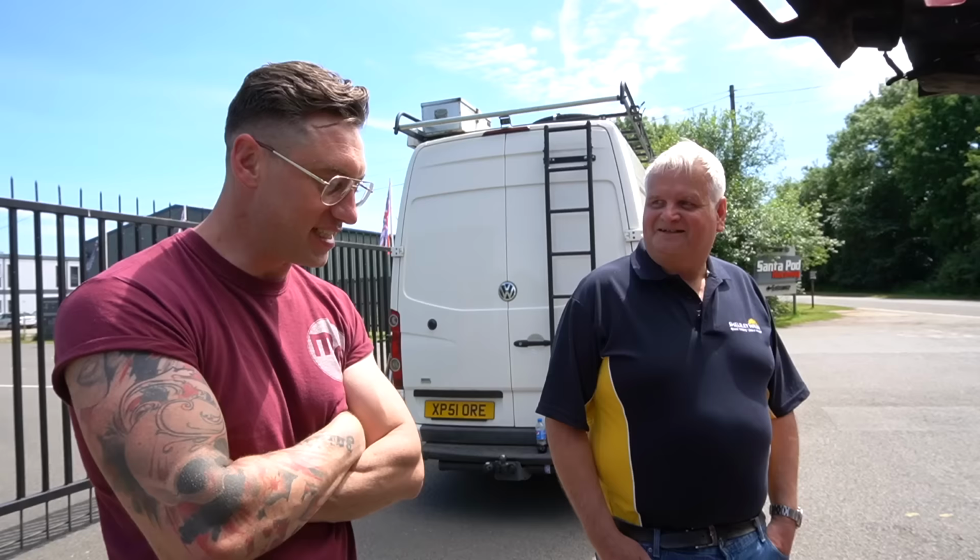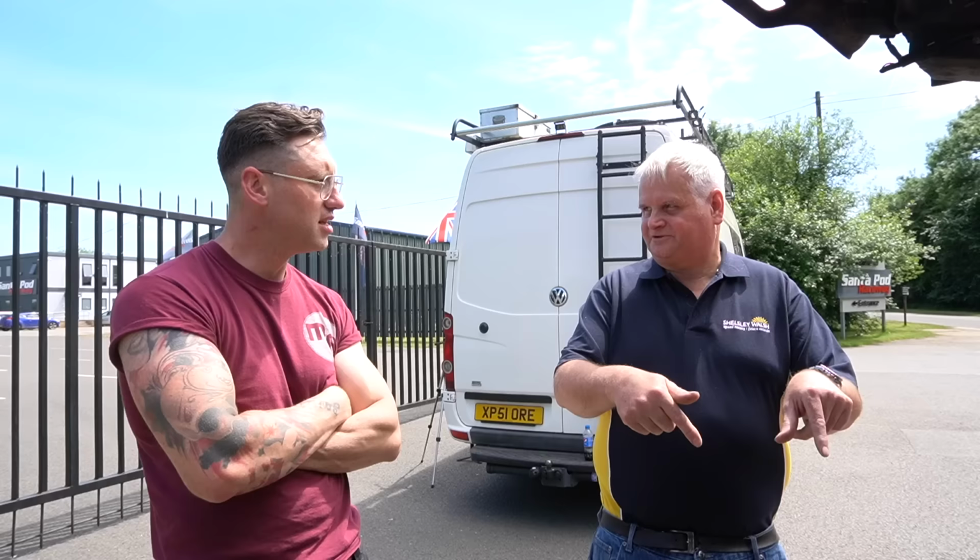One question I like to ask: is there anything over the next year that you think, I must do that, I'm going to change that? Sequential box. Yeah. I'm going to convert that to sequential. Wow. I'm probably going to go the way Lamborghini or BMW did, with either hydraulic or pneumatic actuators on a normal synchro box, and see if I can make it quick without breaking. It's probably foolish me saying, well, has anyone done that before? Because you'll say, I don't care if anyone's done it before, I'm going to do it anyway. Doesn't matter, does it? No.